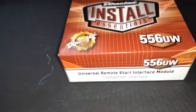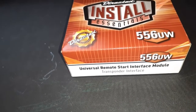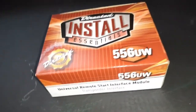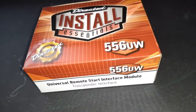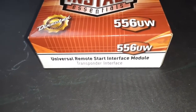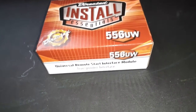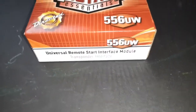If you go back and look at my last video, I did an unboxing of a Prestige APS RS1Z remote starter and I was talking about how some vehicles — after 2000 and up — need an extra key bypass module. A lot of the Fords, Lincolns, and some of the GMs after 2000 had what you call a PK3 or transponder key.